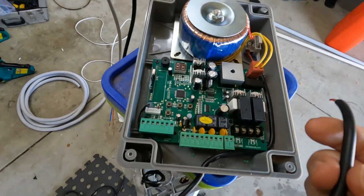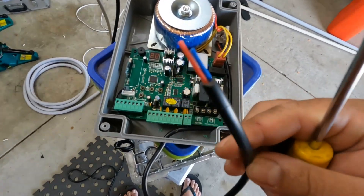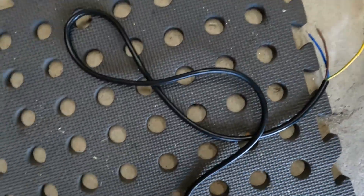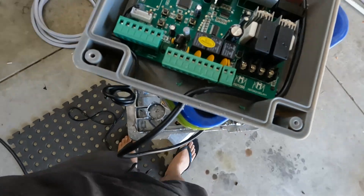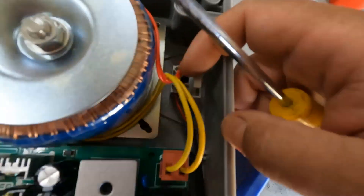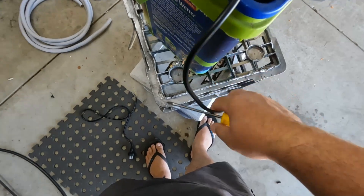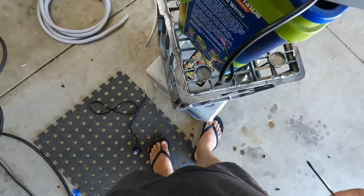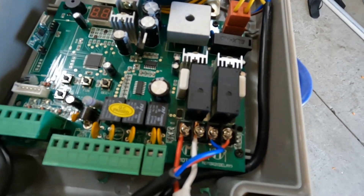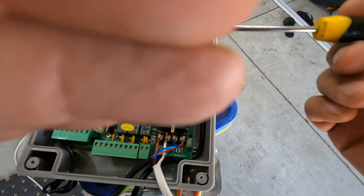Another thing — you'd think they would just put a plug on the AC cable, but it comes shipped with a cut end. I'm actually going to remove that pre-cut cable and wire it directly to the junction, so there's no join in it since my cord doesn't need to be that long anyway. There's an assumption with this control board that one gate has to open first and the other second — probably because most gates might close and latch onto the first gate.